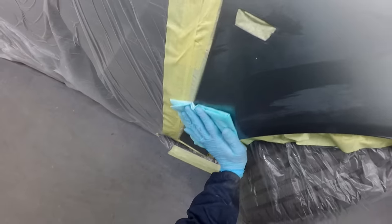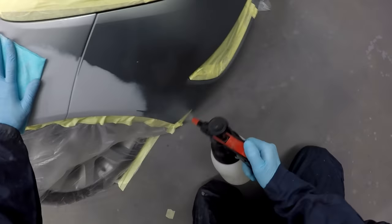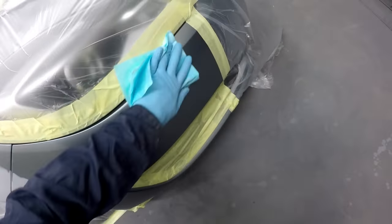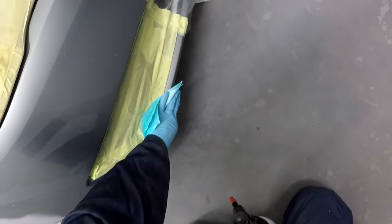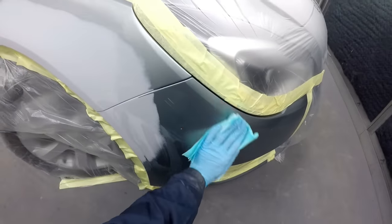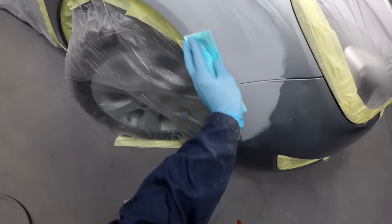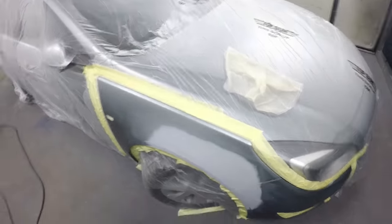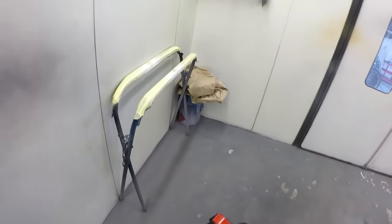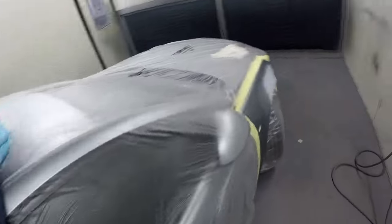First thing I'm doing is getting some panel wipe and giving this wing and everything a good scrub down. I always panel wipe before I mask, but I also panel wipe again before I paint, just to make sure they are extra clean and that anything from masking — like oil off your hands — doesn't transfer onto the car body. This second panel wipe is an extra precaution, especially with trade cars where tyre shine or silicon may be present, making sure the panel is free from oil and grease.